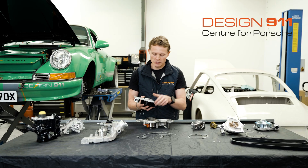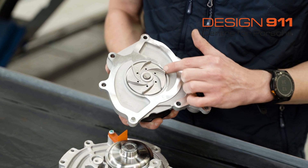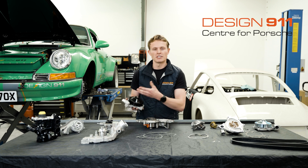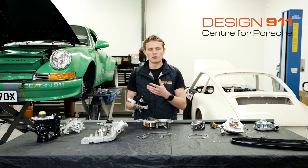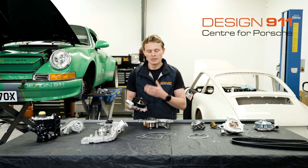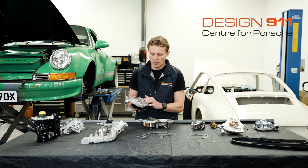The water seal is to stop water escaping. This is a water gallery — if water gets in behind the impeller and through that shaft, water could come out the front of the water pump if you didn't have that water seal. Water seals can go wrong over time; they can age and the rubber can no longer act as a seal, and you get water coming out the front of the pump. That is one failure mechanism — the water seal going.